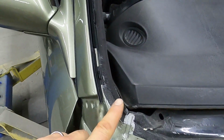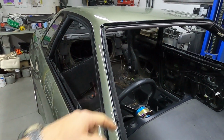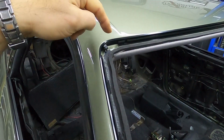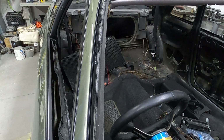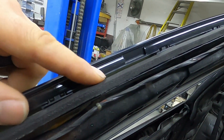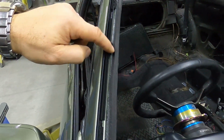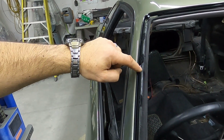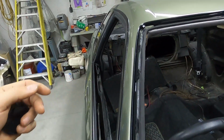Okay, so here we have the foam dam put on. And you can actually see this in the manual, so I'm not making this stuff up. Now, what you're meant to do is put the urethane in this sort of trench, and you have to make sure that you put enough so that it goes above the foam. Inevitably you're going to have some of that urethane go into the track here, where the clips engage. So you're essentially going to be gluing those clips in by default.